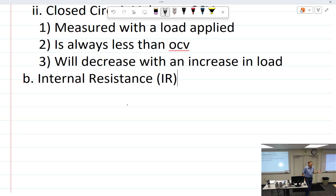Somebody have a dead battery who tried it? What'd you guys hit? We were hitting 30 amps when we started charging, and it literally couldn't hit 14.2 volts. Okay, and then 2 minutes later, 14.2 volts, 24 amps. There you go. So they're trying to bring up the voltage, but the current was so high, the machine's like, we got enough current right here, we'll stop.